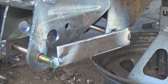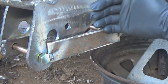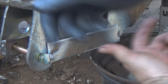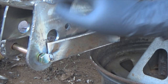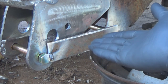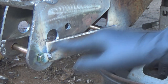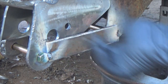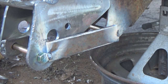Now some of you who know the fabrication game very well may call me out on something — I'm gonna go ahead and call myself out. Whatever I mentioned about this being on the plane where it offsets out like this, I can't take this jig and roll it around to come in from the other side, because the offset is different. When I get this fabricated from that side you'll see, but whenever I slide it in from this side, I'll have to slide it in from under the Jeep to keep my centers correct and my plane here being zeroed out. Otherwise if I flip it around it changes on my Z-axis.